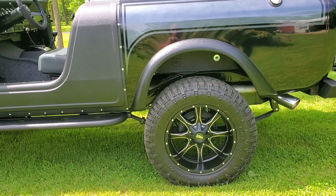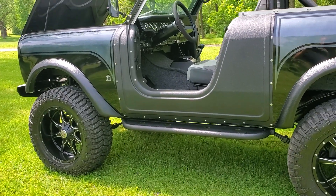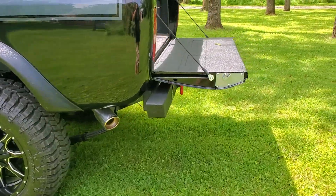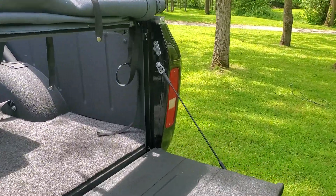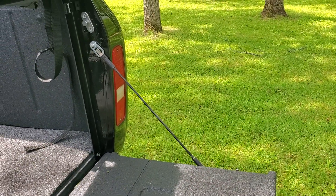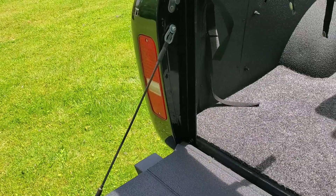With the Rough Country 4-inch springs it allows you to run 35-inch tires without doing a spring-over. I also corrected the steering geometry at the same time — put a heavy duty drag link and tie rod in it, all rod and heim joints in stainless steel. I also put nice cable straps on the tailgate to do away with the clanky noise-making metal straps.